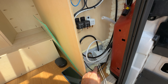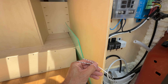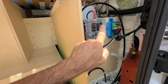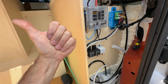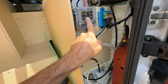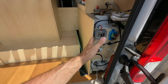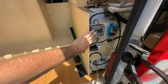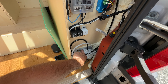I have a temperature probe connected to the thermostatic board over there, but instead of powering straight from the board to the heating element, I thought it's best to have a fuse and go through one relay. The electronic board is going to control the relay, and the relay is the one giving power from the fuse box to the heating element. That way it's completely separate — the power consumption is coming all from this fuse box.